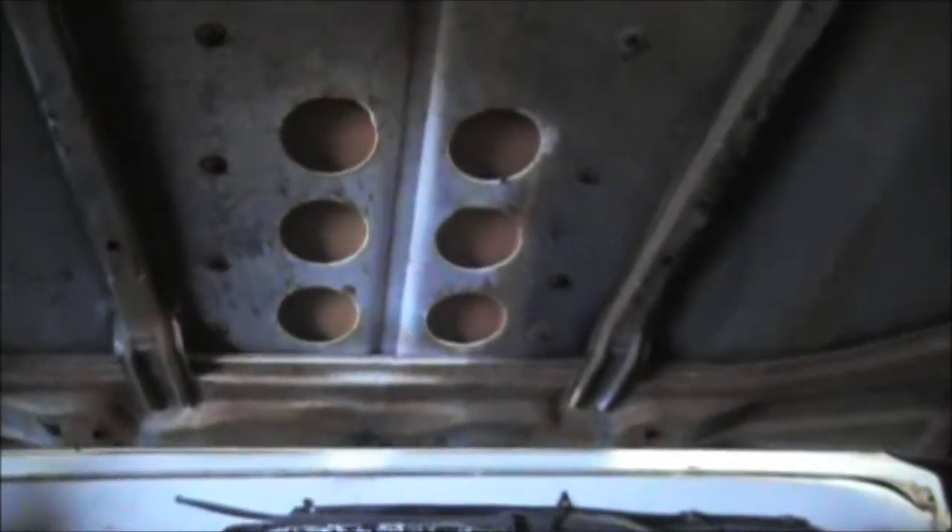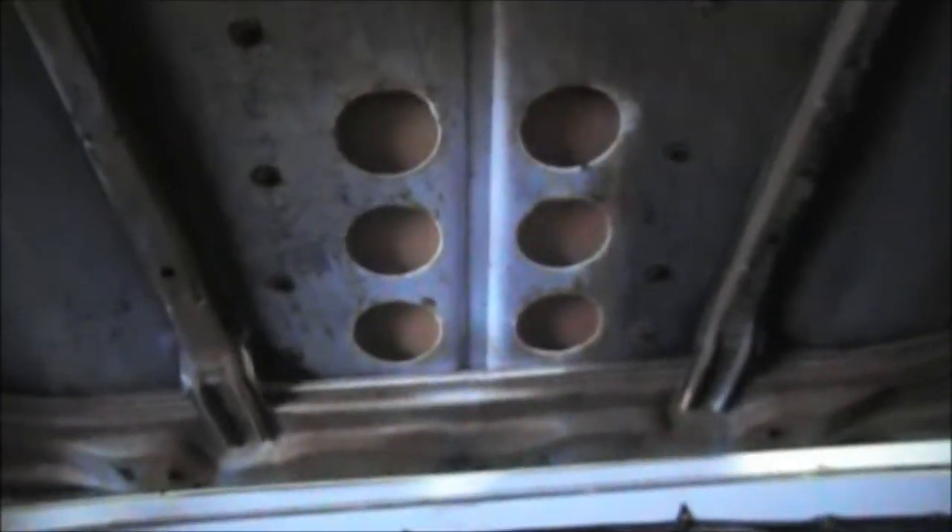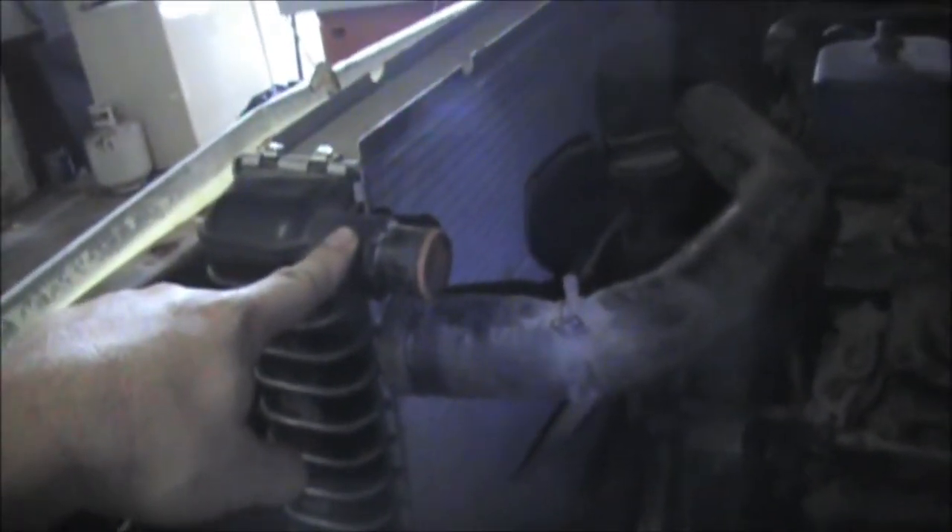Something that's always kind of annoyed me about this truck is a previous owner cut numerous holes in the hood thinking it was going to help it cool better. What it was is just the radiator was going bad — it wasn't that the hood needed to have holes drilled in it to help it cool. So I was a little disappointed about that. For right now I'm not sure if I'm going to weld it up or leave it because there is the hood scoop on the other side — I'm kind of torn on the hood scoop. Here you can see there's that necked-down water neck. I'm going to cut that off so it's not necked down on the inside anymore and make it the full diameter, just to make sure we can get plenty of water through it. I'm going to make a hard pipe that goes across coming to the radiator instead of the flexible hose so I don't have to worry about anything flexing and getting damaged.